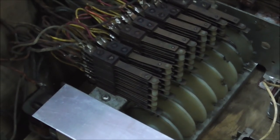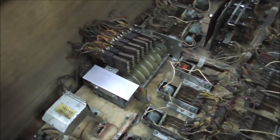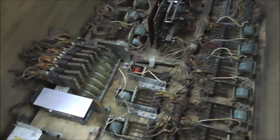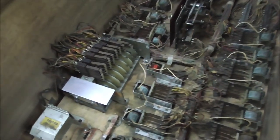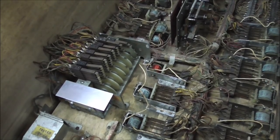We've also got the score motor here with big stacks of switches — same principle. If it's closed, you want it to open; if it's open, you want it to close. As those cams turn around with the little hole in them, the switch stacks drop down into the little chip on the cam and change state. So we've got tons of cleaning to do, and that's really all there is to fixing these things. Then there are the little stepper units we'll talk about in a minute, but first I'm going to clean all of these switches and the bottom of the play field.